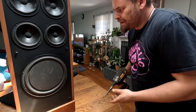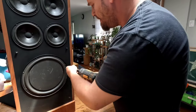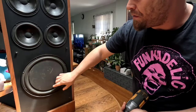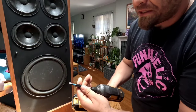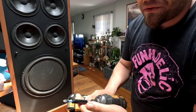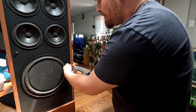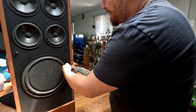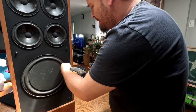I've opted to take this passive radiator off first. Usually when I'm taking speakers off — because this is all very soft foam, even the front is very soft foam — I like to use one of these extensions that has the little ratchet in there so you can spin it. That way you can use your force as you're spinning it and push away from the speaker, just in case it slips off the screw, so it will not damage the speaker.